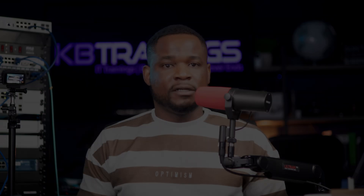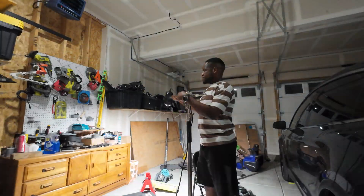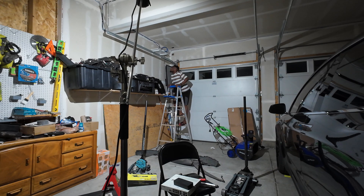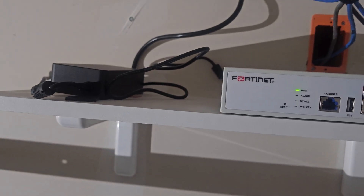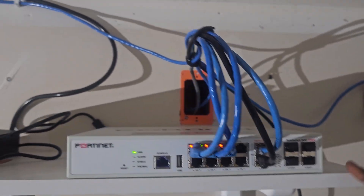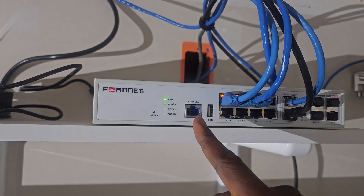So now I'm going to bring this into my garage and install it, connecting all the ports that are needed. In the garage, I had been using the FortiSwitch 108F FPOE — a small switch with POE supporting my cameras and AP, very useful. But now I'm going to replace it with the new 110G POE to take advantage of the 5 gigabit per second for the FortiAP with Wi-Fi 7. I have a power adapter connected, three cameras connected, the 10 gig ports are not used for now, but I'm using 5 gig for the AP. The other 5 gig port will be connected to my home rack.